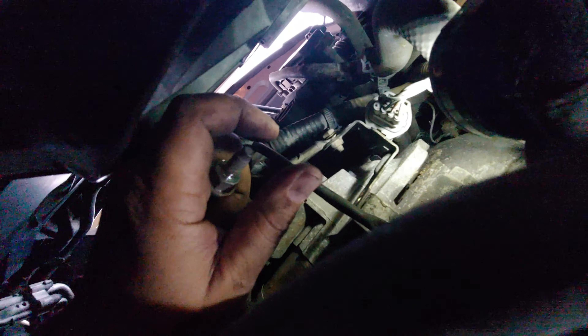Took this off now. This bracket is a 12 millimeter. Finally I was able to get the second bolt. The problem — I think this is the most difficult part of the job — is the second bolt because it's hidden on top. There's no way for you to see it if you're on top, so you have to be underneath and then feel for it. Once you feel for it, then you insert your socket.